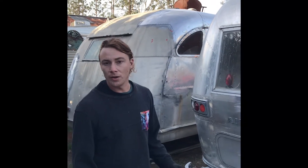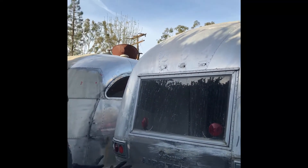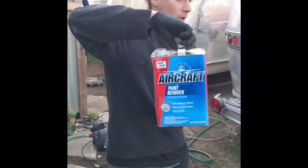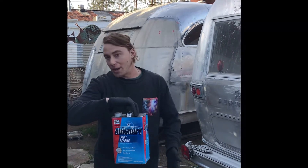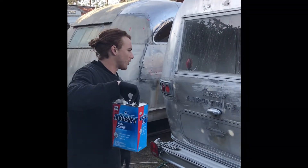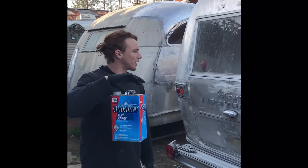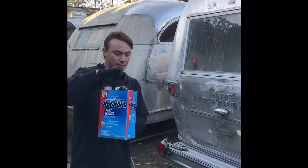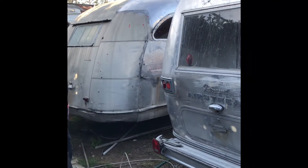One thing to know is that you should do this either early in the morning or late in the evening — when I started this video it was late yesterday evening. The reason is you want the aluminum to be cool when you apply the stripper, whether you're using aircraft stripper, PPG, Multi-Strip, or Klean-Strip. For cost efficiency I'm using aircraft stripper from Amazon. A 25-foot trailer took about two and a half gallons; for a 36-footer I'd grab three gallons and that'll get the job done.